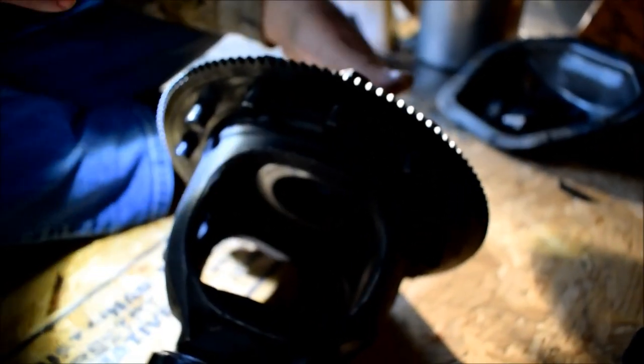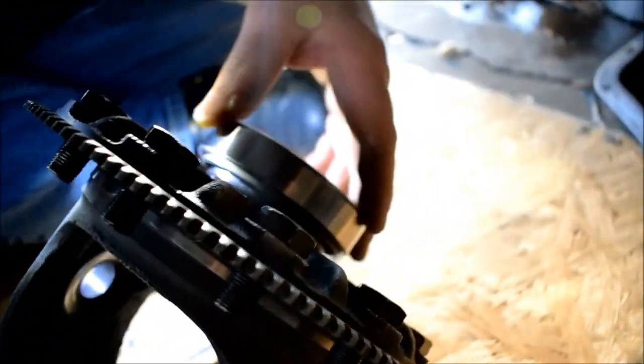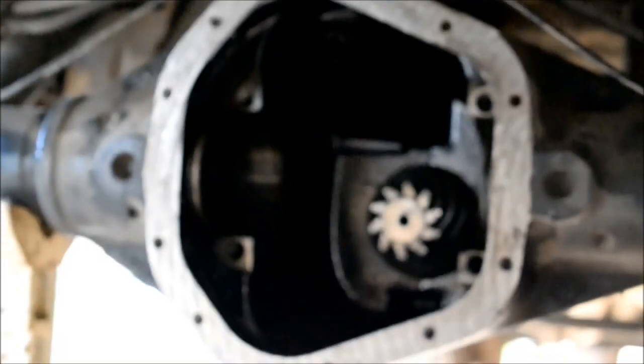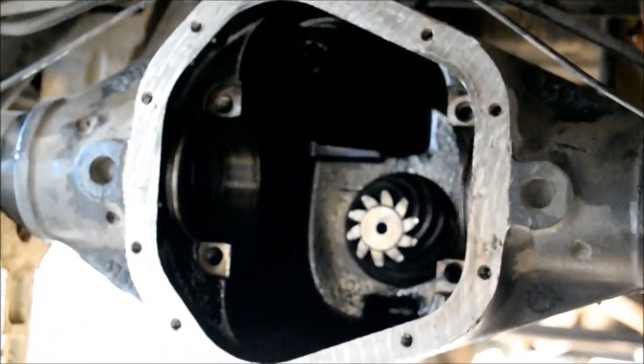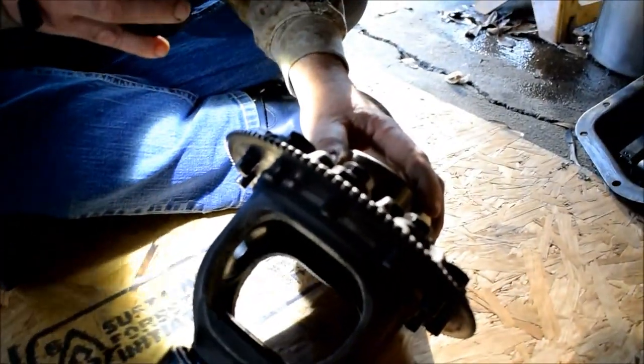Driving. Now, if this rear end gives me a vibration again, first suspect, those bearings, right? Not the Spartan gears, because we'd be changing them out. And if I do change these bearings, I'm going after not just these carrier bearings but the pinion, and the ring gear. So we'll order a set of bearings for the pinion and these two carrier bearings.